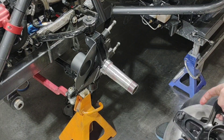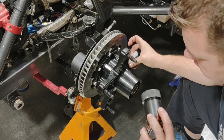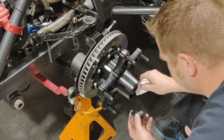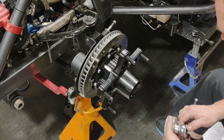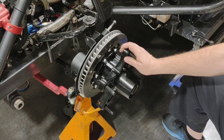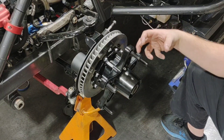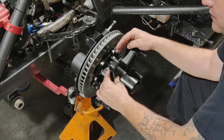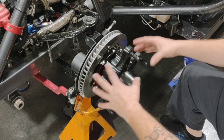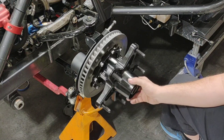I've got a little bit of grease on my race and I am ready to start sliding this thing together. I went ahead and locked down my set screw on my bearing spacer. The reason why it's not spinning as free now is because we've got a little bit of grease on both of those bearings, and the seal is in the back side - that seal fits tight enough that it does drag that speed down. That's why when you set these up, don't put the seal in the back yet. Make sure you have dry bearings and the seal is out so you can set it up and know exactly what you've got, because when you assemble it with grease in the bearings and that seal on the back, you do feel some of that drag from the grease.